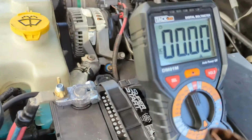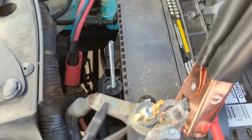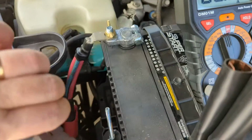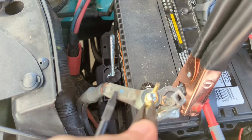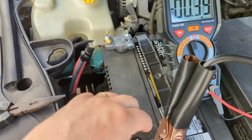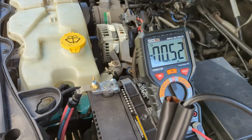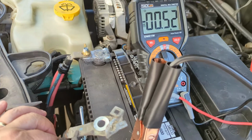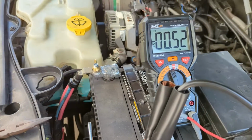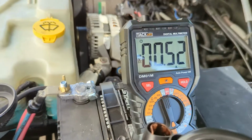So now we can take this thing off here. This little botched thing I got here. I know I need to fix this, but this is how I had to do it. Now when I pull this apart, you see I've got current flowing through here already, because I've already made the disconnection. See, I've got 520 milliamps running through here. You see how I got this? I got the black one on there, this is off, red one on there, it's in series, 520 milliamps.